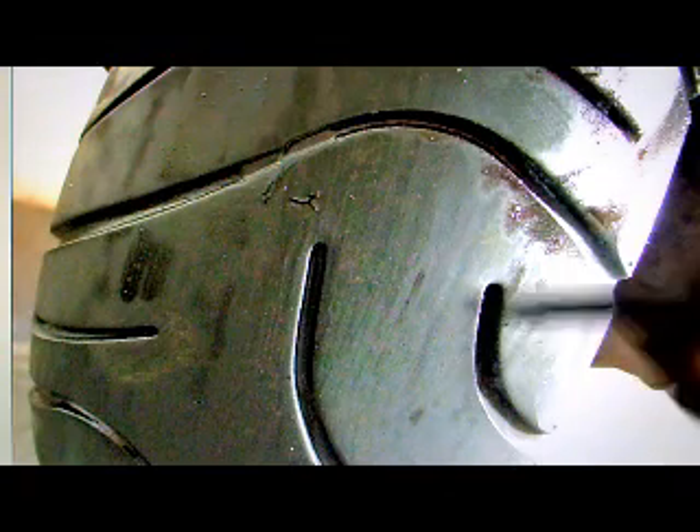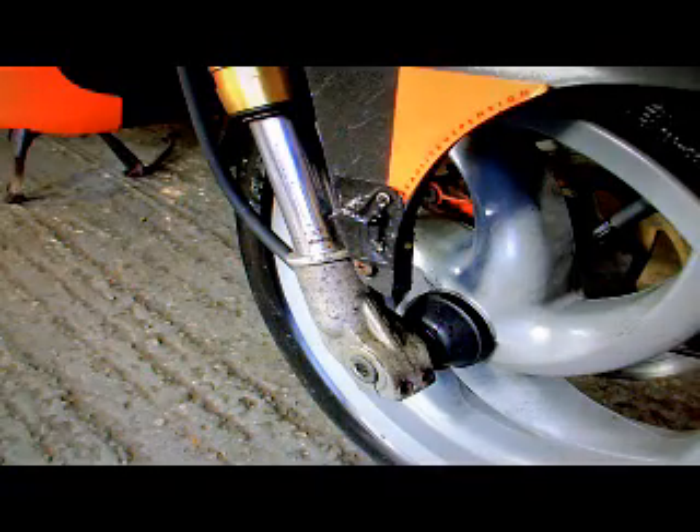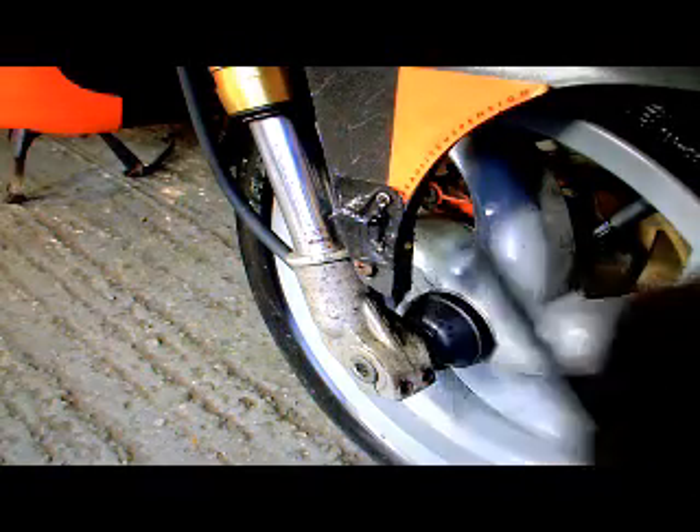The rear tire leaks air. I think this is because the tire has gone flat over a long period of time and dust has got in between the rim and the tire beading itself. If you clean that out I think you'll probably find it will seal, but the tire is a bit worn out as you can see, so you might want to change that.